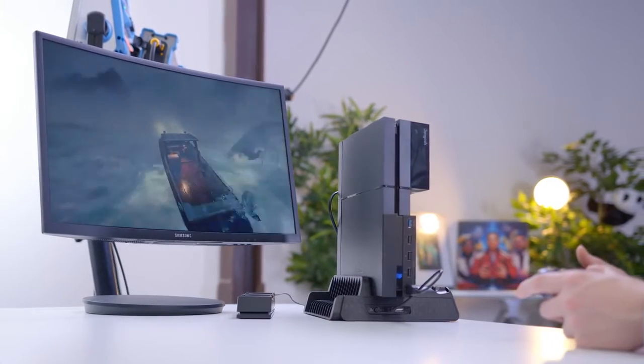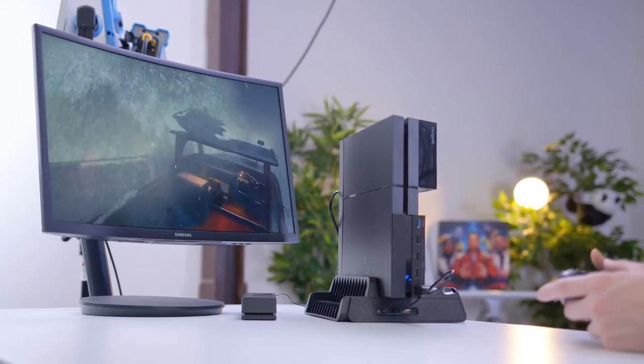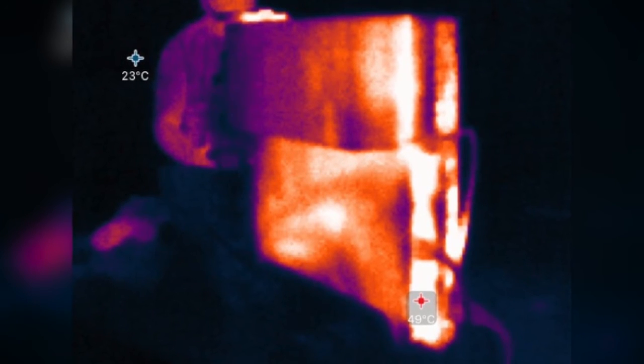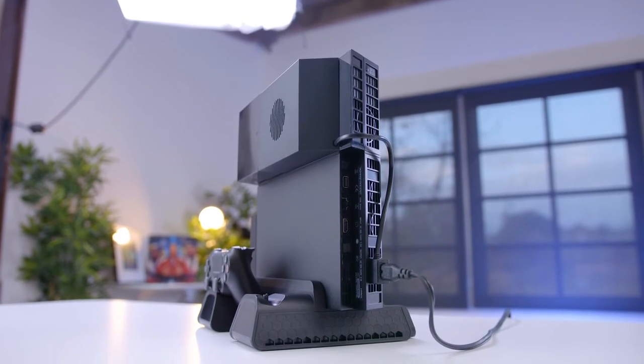So what I'm curious about are the temperatures. I can pretty confidently say this is louder than a normal PS4, but I'm curious whether that loudness actually does anything. The PS4 with the intercooler and the cooling stand topped out at around 49 degrees at the exhaust. However, when you take all that stuff off and run it, it tops out at about 50. The intercooler is just adding additional fans for the exhaust — it's still restricted by how much intake air can get into the PS4. The cooling stand in theory would help by giving it fresh air, but the actual intakes themselves are tiny and really not able to make a big difference.